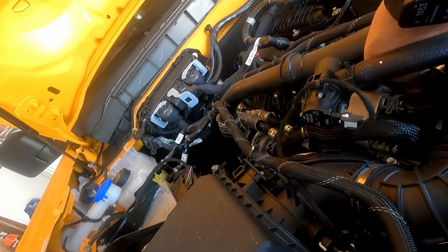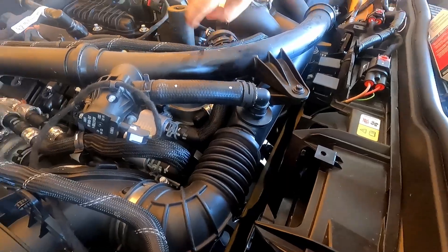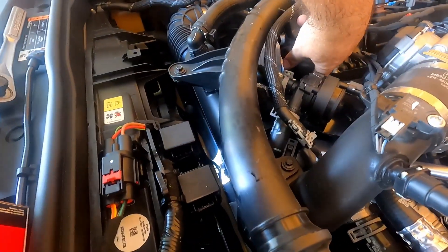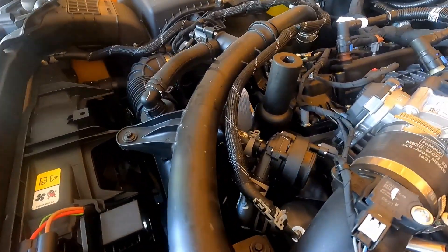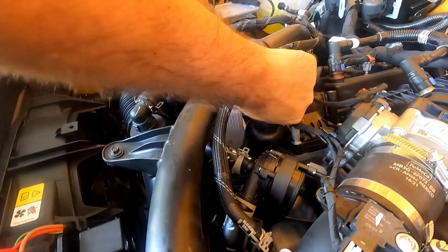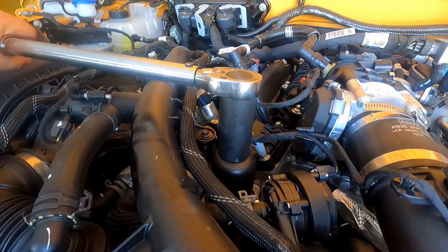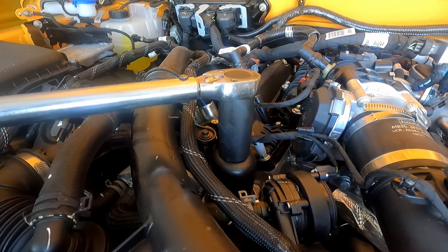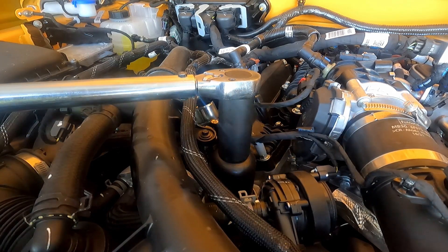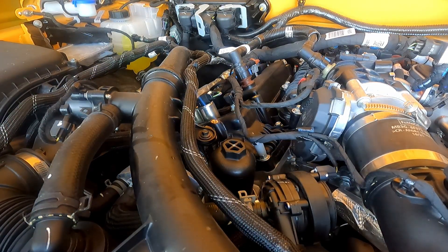Going to put a little oil on those o-rings. Make sure the bottom of that cover is perfectly seated - no o-ring sticking out around the edges. You should feel those o-rings start binding as you're putting it in. That went in pretty smoothly. This should be 24 foot-pounds - just pretty snug. For the sake of being by the book we'll use the torque wrench, but if you don't have one, just snug should do the trick. Let's go back down under.